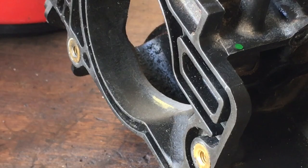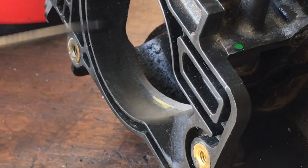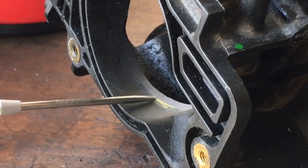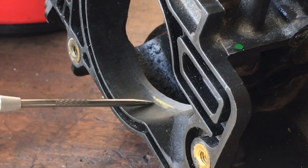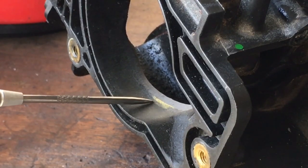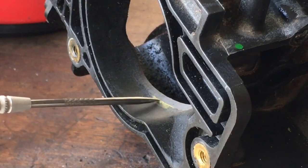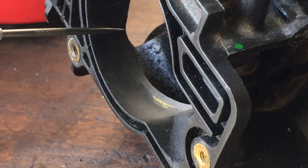Here's a little bit of an in-process look at what I'm trying to do here. Before, you have your outer lip where your throttle body comes on and bolts on — there was a huge step. That step is still there, you can see where it's poking in. This area is flat, then there's a step. That step went all the way across and was really tall — probably about that tall — and it went all the way up to here.